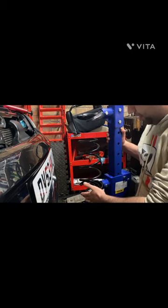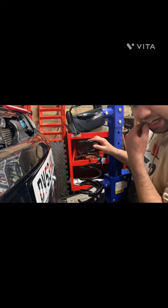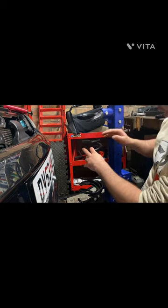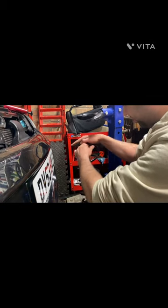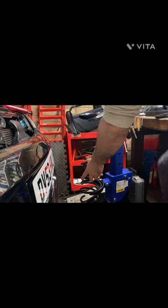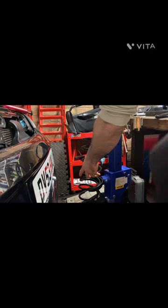So I've got the spring in the compressor. I've left a gap there so you can get the shocker in — you can adjust this so you've got less travel. This is a brand new spring off a Corsa D, so a typical run-of-the-mill car, nothing big. Let's give it a go and hopefully it doesn't all go wrong and damage the Astra. You've got a big pedal on the right — just pump. One thing I'm noticing is that the jack feels quite loose; doesn't feel like there's much resistance, but I guess it's not really compressing anything yet, so that could be normal.